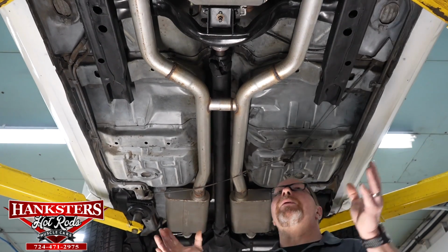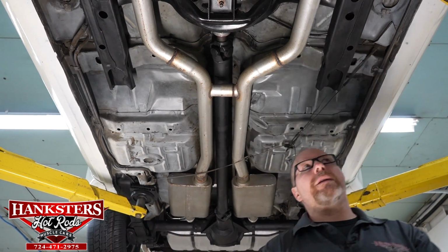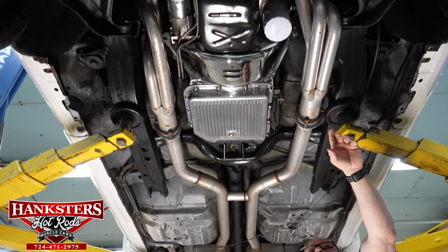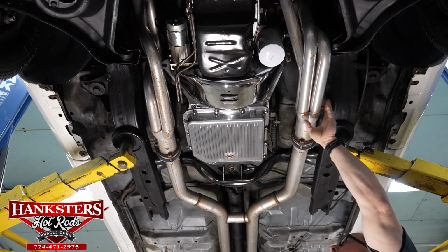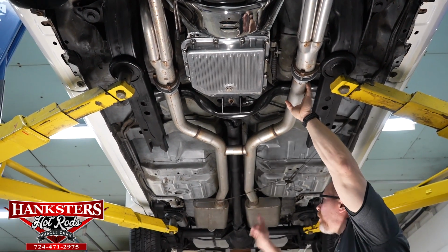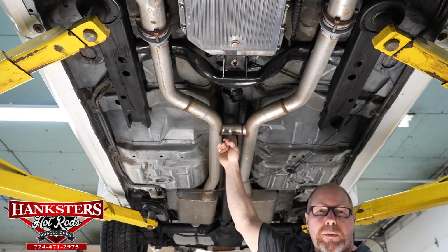So that's pretty much your drive line except for the rear, but we'll get to that as we get a little closer there. Exhaust work, as you can see, 1 3/4 inch long tube ceramic coated headers, and then those empty out into 2.5 inch exhaust all the way back. It does in fact have the crossover pipe here.